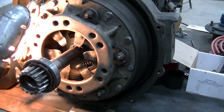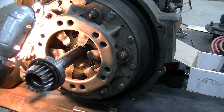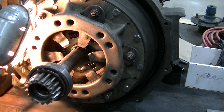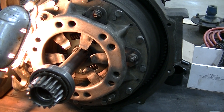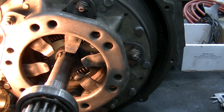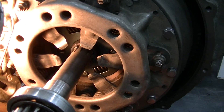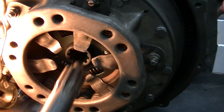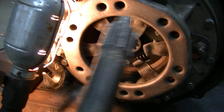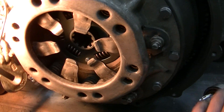This is a Model A Ford engine that ran well and the clutch worked fine; the transmission needed work. There wasn't a lot wrong with the clutch disc — we put a new one in and we're reusing the pressure plate, which seemed to be fine. To adjust the fingers it calls for three-quarters of an inch, so I used a pilot shaft with good splines to line up the clutch disc and tighten the bolts down.